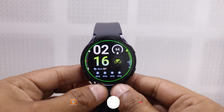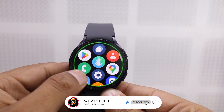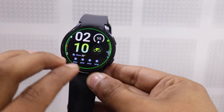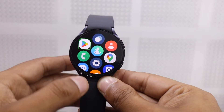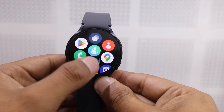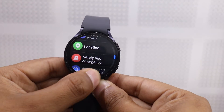As you can see, the Voice Assistant or TalkBack is currently active. Let's disable it with the help of the smartwatch first. On your watch home screen, swipe up with two fingers to access all apps. Tap on Settings and double tap again to open it. Scroll down by using two fingers, or you can use the bezels to scroll up and down.